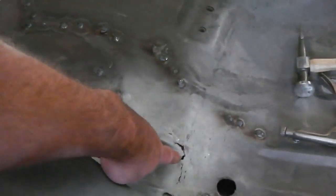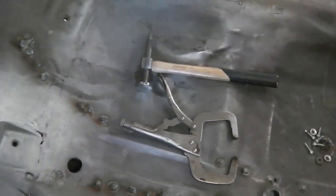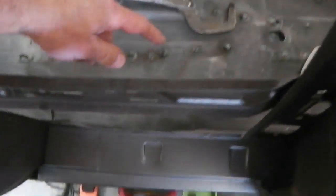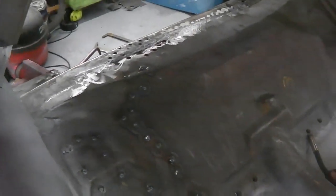There's a little break in the weld there. We need to repair that. And then we can pop some paint on, because before we put the crossmember back, I want that all under there painted and ready, and seam sealer on before the crossmember goes back on, because I won't be able to get to it otherwise. So this morning's jobs is clean up work and a bit of prep work. A few more welds to put in the top there, you can see they need doing. We should get them in really now, and then they're out of the way. So a bit of welding, a bit of cleaning up. Here we go, looking good though.